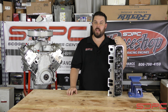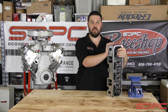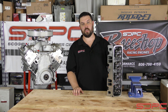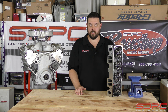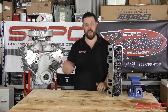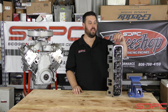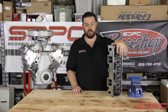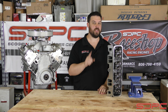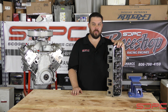Now, if you still have a set of Vortec heads and you're still looking to do the same things that we did, we can absolutely still help you out. We can sell you this valve spring kit — we sell them on our website all the time to guys taking their stock heads to their local machine shop. We also have some guys that run the Comp valve spring and retainer combo. It's a pretty trick thing. You can run the LS6 valve spring, or the Comp 918s or PAC 1218s, with a Comp 787-16 — I believe that's the part number, we'll double check that for you. With that part number, it is a drop-in valve spring replacement that will do almost 500 lift, give or take.